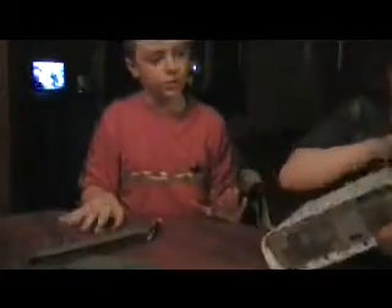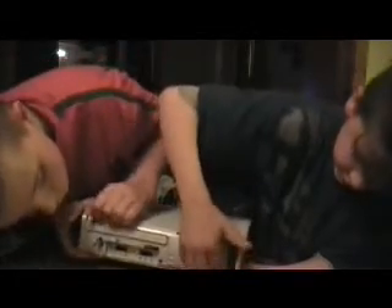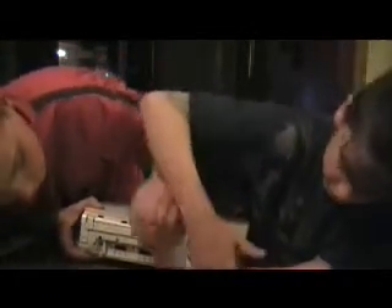This part gets really noisy at times. You will have to — see these? There are four pins on the Xbox: one here, here, here, and here. You just want to pop them. They're just really hard to pop without a tool. Why don't you use a flat screwdriver? If you can just pull this up, Cody.